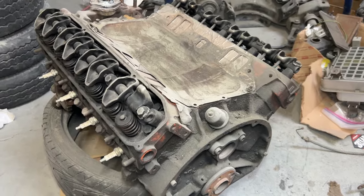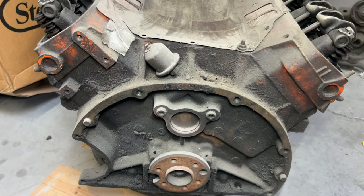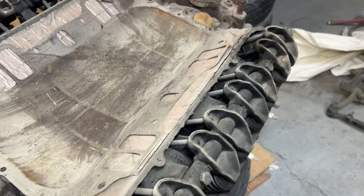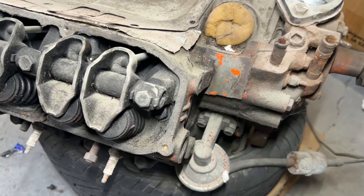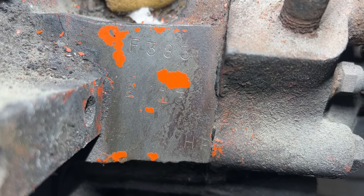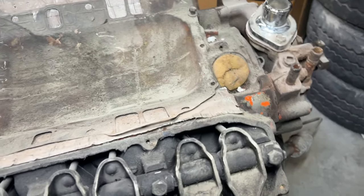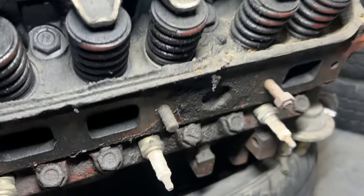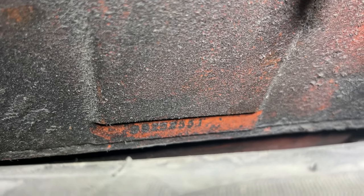These next shots will be focusing on the different driveline components and the numbers. The engine looks to be all original and, in my opinion, doesn't look like it's ever been apart. The car has 83,000 miles on it, which is consistent with the way this engine looks. As I focus in on these numbers, they are consistent with the build date of the car, which is 2/19, or February 19th. As I focus in on the partial VIN on the block, you can see it's also consistent with the matching numbers to the fender tag, the VIN tag, and the broadcast sheets.